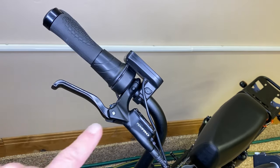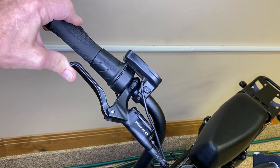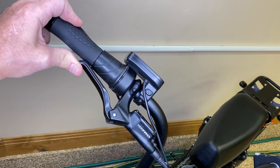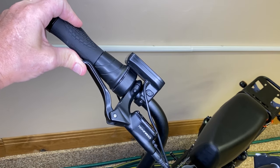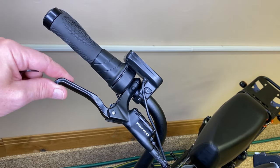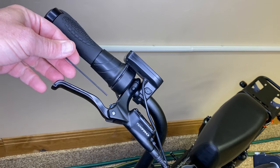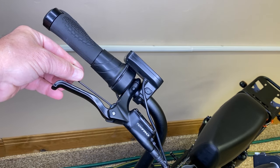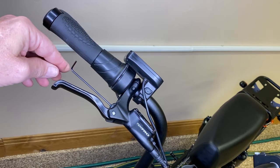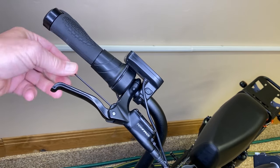What's up tubers — here we are with Tektro. If you've got an e-bike from China made by Juiced Bikes, these are your brakes. Look at that — spongy, compresses all the way down to your lever. Did you know these are adjustable? That's right, the reach is adjustable. That sponginess is not. You're going to need a two millimeter hex head wrench, and right here inside your hand lever is an adjustment screw.